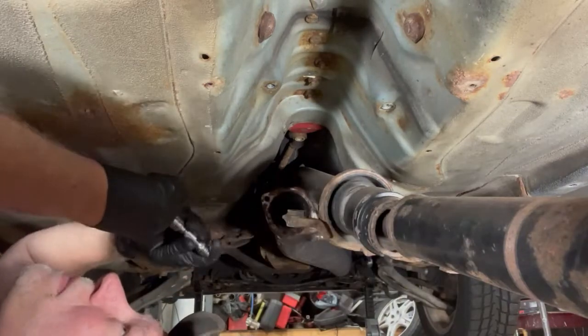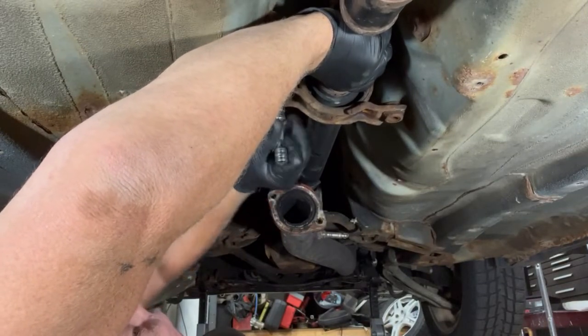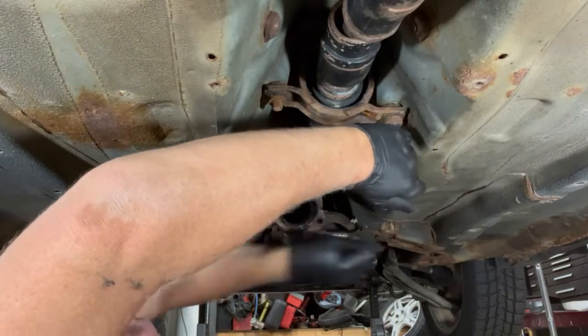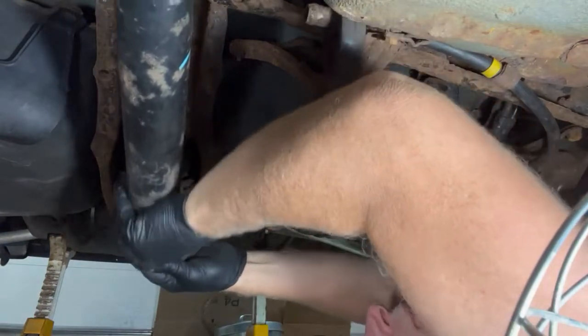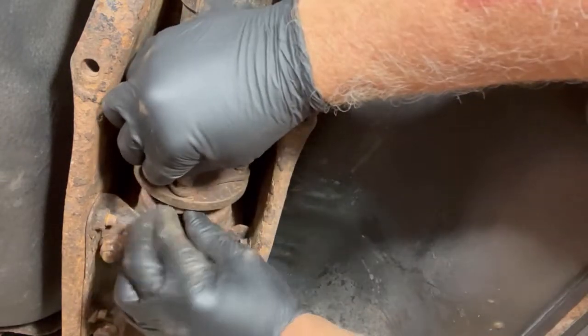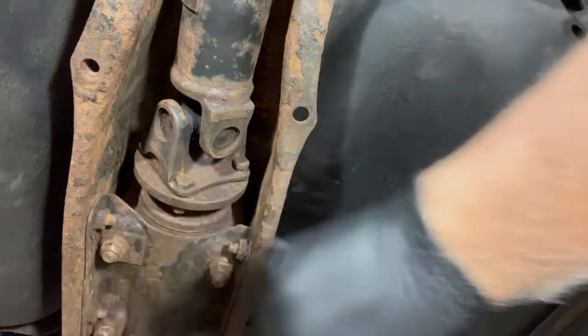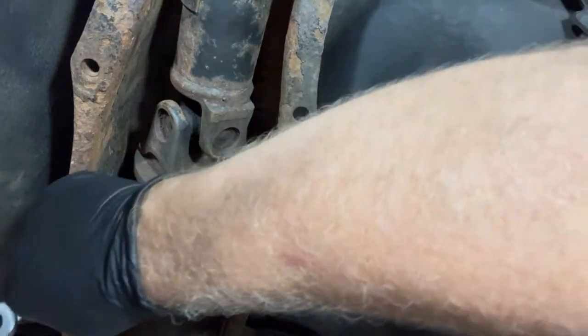Trailing arm to body — this is going to get torqued to 85 foot-pounds, or 115.24 newton-meters. Putting the 12-millimeter bolts back in the carrier, get them started and snug them up, then moving on to the U-joints. Driveshaft flange to differential — I'll tighten everything down with a 12-millimeter wrench, holding one of the wheels to keep it from spinning. That wraps up the repair for the Subaru. Everything worked out good — I've been driving around a bit and everything feels nice and solid going down the road.